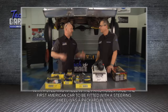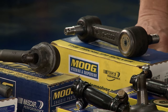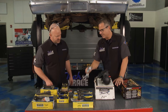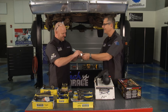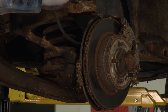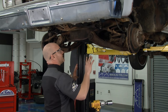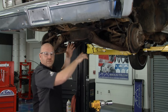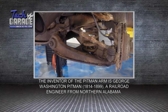Once we're done it's going to drive like a 2017 — like new. RockAuto has the parts and also the tools to do the job; we got the pitman arm puller and the pickle fork right here. Our first step is to drop the pitman arm, then the tie rod ends, and ultimately the idler arm — this whole system is going to come out as one piece.